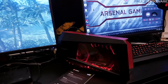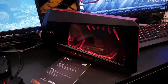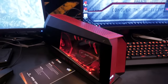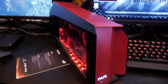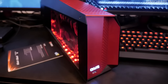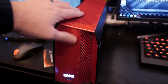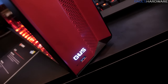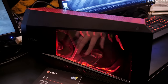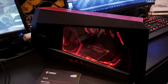Down here is GUS — the Gaming GPU Upgrade System. Basically it's an external Thunderbolt 3 GPU dock. It includes a 500 watt 80-plus Gold power supply. If you have a device capable of Thunderbolt 3 connectivity, you can just plug it in and use an external GPU — great for a very tiny mini PC or a laptop you want to game on. It's a very asymmetrical but all-metal design with plenty of ventilation. Up front is a USB 3.0 port that supports quick charge. Inside they have an MSI GPU which I'd assume is a GTX 1080, and in the rear there are a couple USB 3.0 Type-A and a couple USB 3.0 Type-C ports. It should be less money than the Razer Core, though pricing hasn't been confirmed yet.